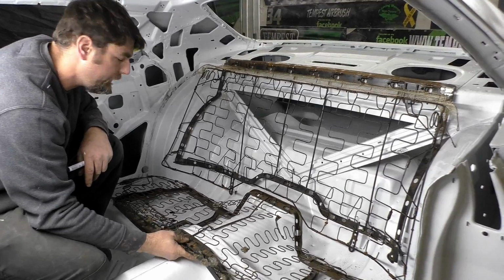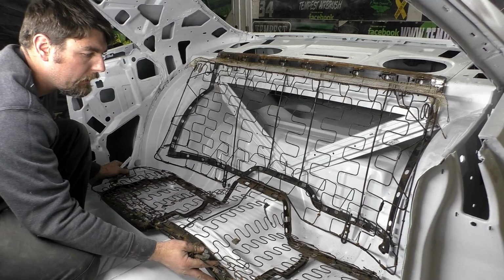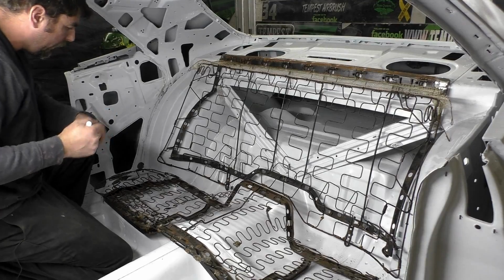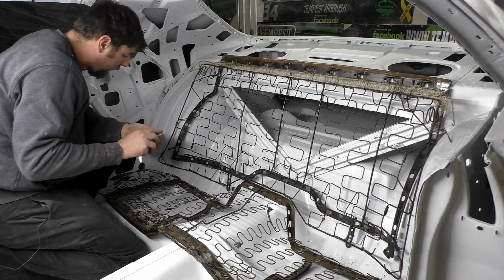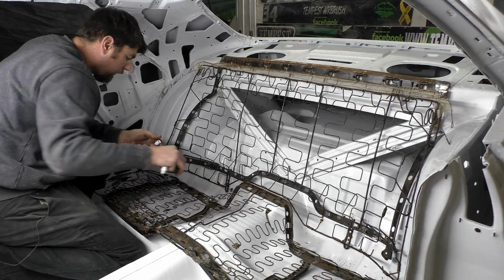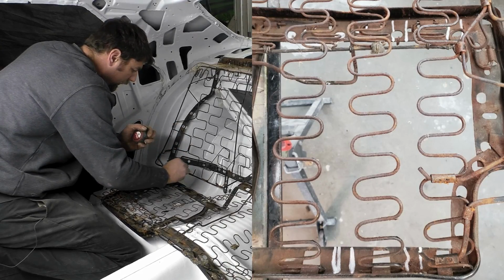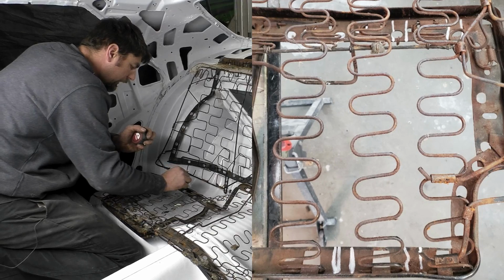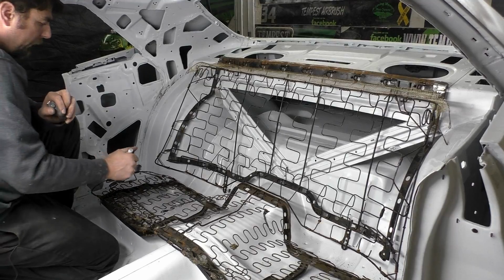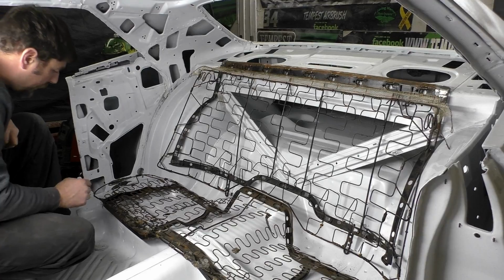So the bottom seat basically slides back and then clips in these front clips. What we need to do is kind of the same concept. We're going to try to leave the top alone, but we've got to bring these springs in here. Measuring it out, we need to go about 1.25 inches in. So what we're going to end up doing is take 1/2 inch out of this one right here, tack it, and take 1/2 inch out of this mark right there. So that's going to pull both of them in. We might take a little bit more out of this one, and that's going to compress the back.